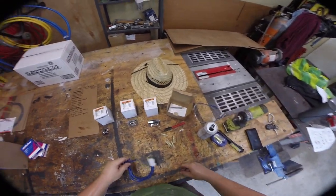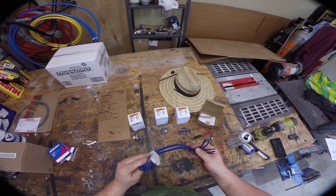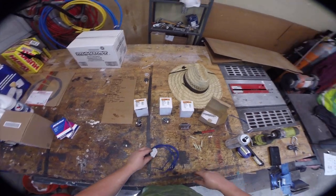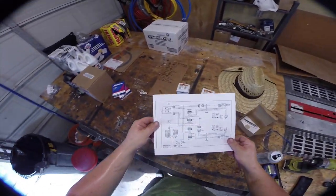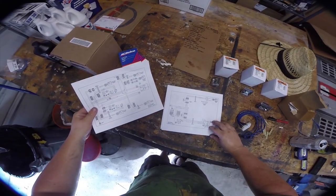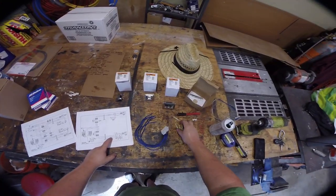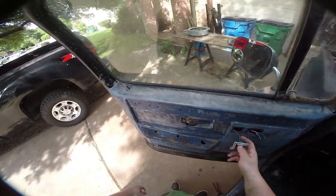We're going to switch tracks and figure out what's going on with the power windows and power door locks. This is a replacement kit for the pigtail that controls the main window switch on the driver side — these are replacement units from Dorman. All the part numbers and Amazon links are down in the description. Unfortunately the instructions that come with this are not great based on Amazon reviews, so we have the actual wiring diagram here. We can see which pins are supposed to be which color — they've made all of these blue, which is kind of dumb. We're gonna crimp all of these on in the door panel.